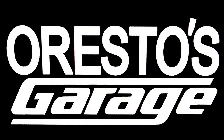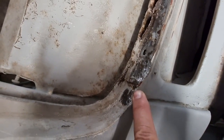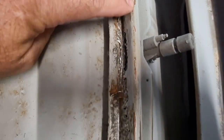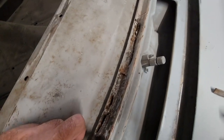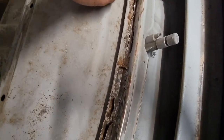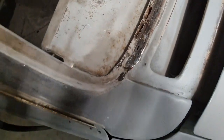So what I'm doing here - I've marked out right here into this weld, and I'm going to cut along here, all along here. Then I'm going to chisel out all these rusted spot welds. If I can find some I'll drill them out, otherwise I've just been tapping them in. I've cut along the top edge and cut down all the way through this one here.